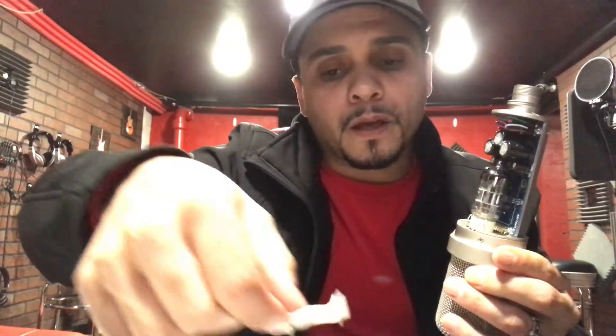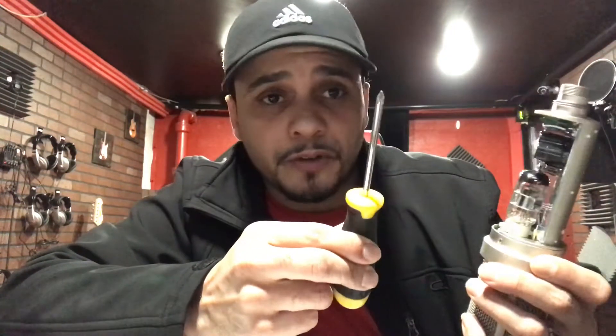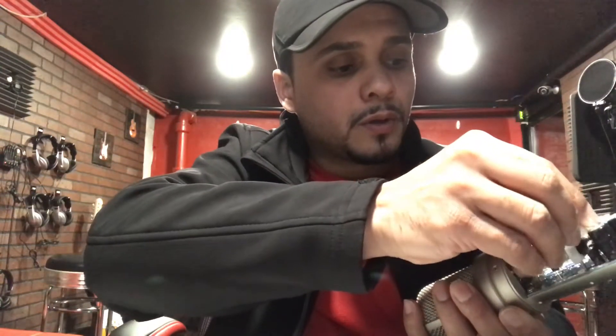Be careful when you lift up because the circuit board is right there. The tube is right here. I went ahead and unscrewed the safety guard. You will need a thin Phillips screwdriver — number two is perfect.